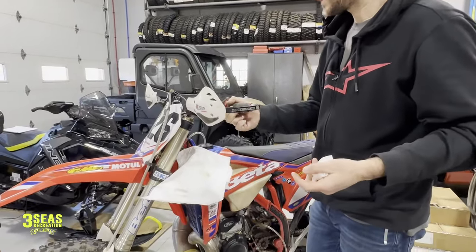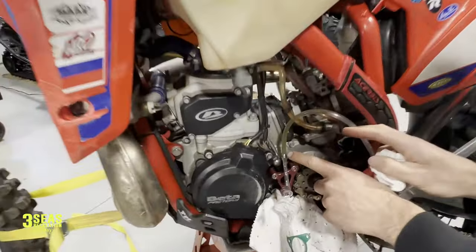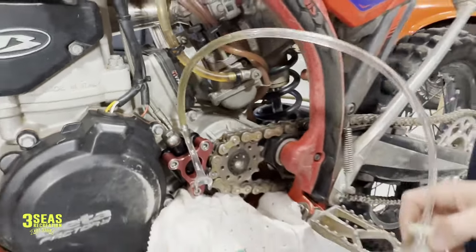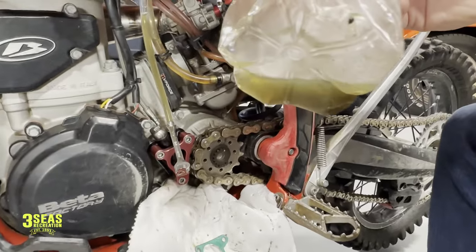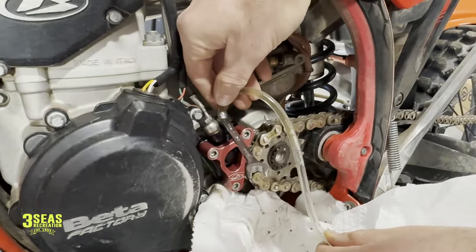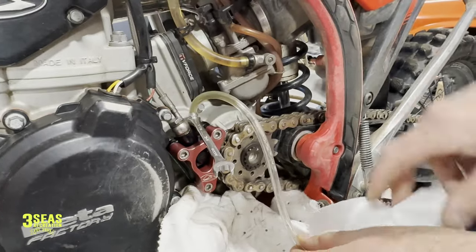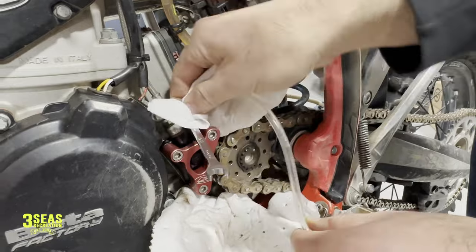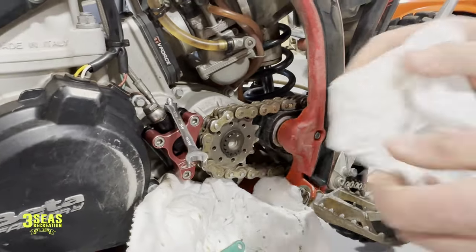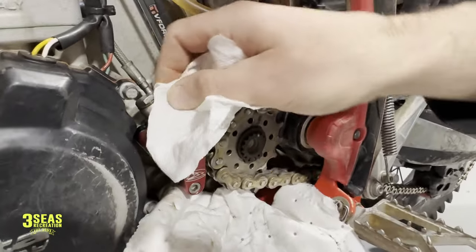We only spent like two or three more minutes — we really don't have much time in this. Got a total clutch feel to it, and if you zoom down here I will show that we're getting all clear fluid — this is all the exact color of the fluid that we're putting into it. Here's an example of what the fluid did look like — it's nasty. At this point I tip this down to drain all the fluid out of my homemade tool to make a minimal amount of mess. Then I grab a paper towel, kind of pinch around it, pinching the hose. Make sure your bleeder's screwed in — just give it one final little snug there.